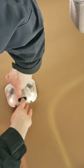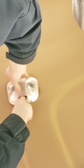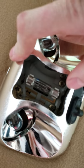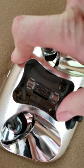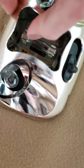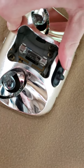When you pull your lens off — mine fell apart — you'll get something that looks like this. What you're going to do is pull these three screws out. Each of these screws actually serves a purpose as the terminal; there are no wires in this unit. This is the ground, this is the dome light itself, and this is 12 volts for the map lights.